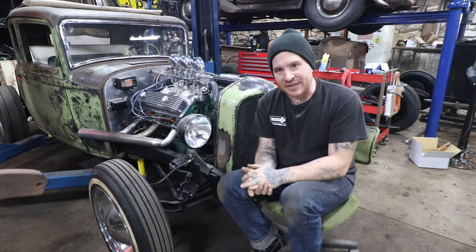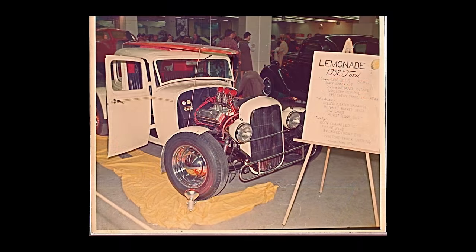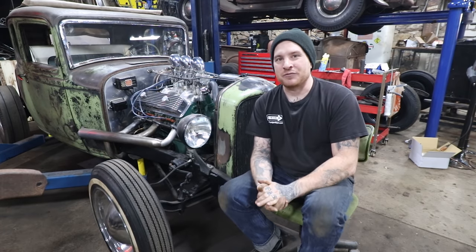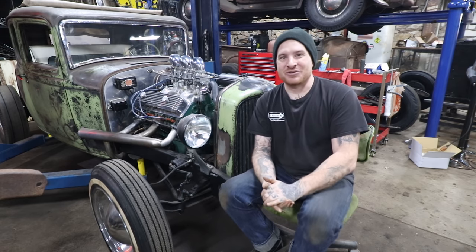It's not uncommon to see old hot rod engines where they take two valve covers, cut them apart, section them, and add height to them or add spacers underneath. There's all kinds of things that guys did just to get their engine together. I'm sure a lot of guys put these things together with their new Isky cam and rockers and everything, went to put the valve cover on, and it didn't fit. The other thing you can do — and why you see on a lot of these Oldsmobile engines having finned valve covers — is because a lot of the finned valve covers were made taller to have clearance for adjustable rockers. That's why they were so popular. All different brands made them: Moon, Edelbrock, Offenhauser. Valve covers can get very, very expensive when you get into the rare ones.